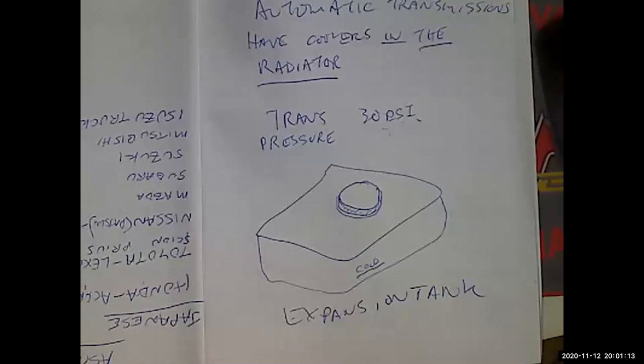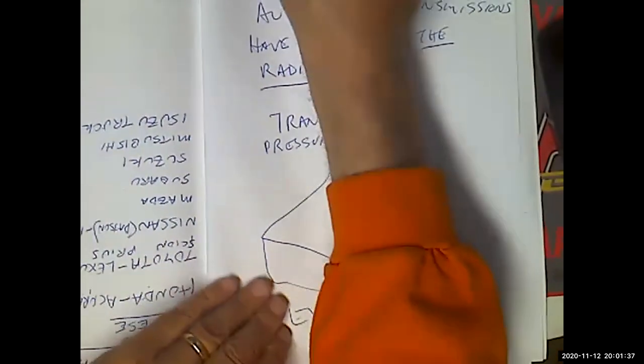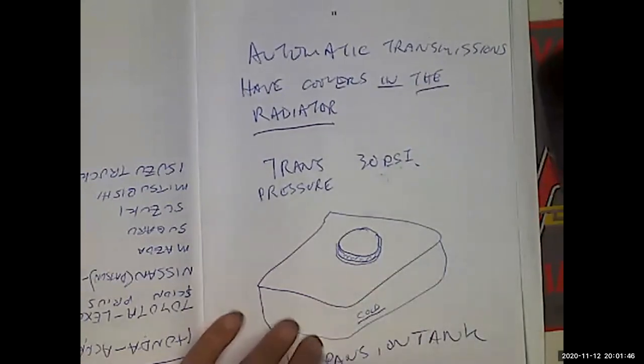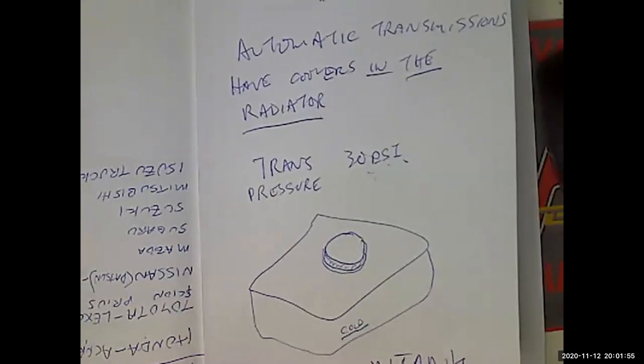And you should definitely have an expansion tank, that's minimum. You can't be dumping that crap all over the street. So when you look at your coolant level, it's probably going to look lower than you think it should be, because it's going to expand a lot. So how do you know? Well, most expansion tanks, say, for instance, on a 98 Mustang or something like that, have a line on it that says hot and cold. You want to check your level that way and just let the radiator take care of itself as long as your radiator cap is operating correctly. Yeah?